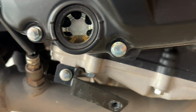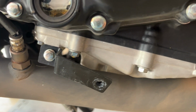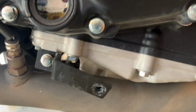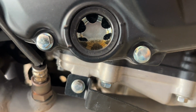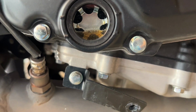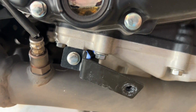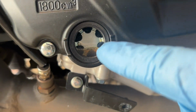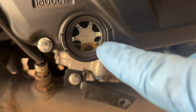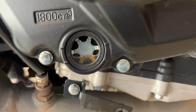And as you can see from that, sorry, I moved a little bit, we're above the low mark, pretty good. It's actually more than what it shows in the camera. Sorry, trying to get the camera in there. But we could stand to have just a little bit more oil. Now, the difference between those 2 marks is not much. It'll move quick, and it's a little confusing. I keep moving the camera around, but this mark right here is not near as low on the bottom end as it shows on the camera. It's actually up a little higher than that.